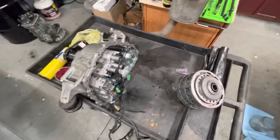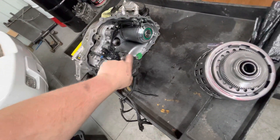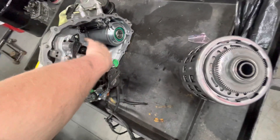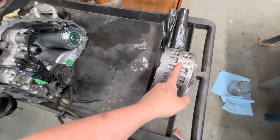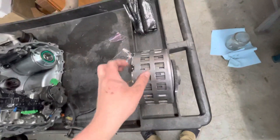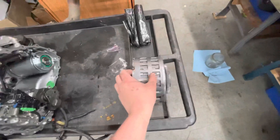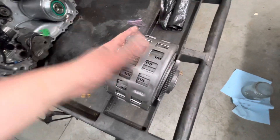The ECU sends an electrical signal which will activate one of these clutch pack solenoids. That will send oil up into this input hub sealing surface, and that will in turn flood one of these clutches. There's a piston inside of here — basically that piston will force these synthetic discs together. It's some kind of automatic transmission style clutch that clamps these together, which then will lock one of these input shafts to the outer basket.